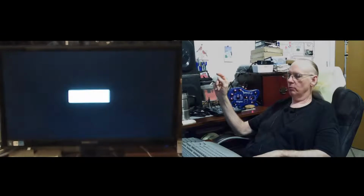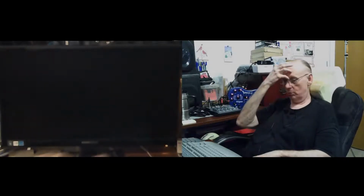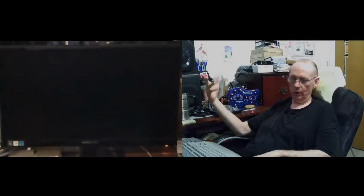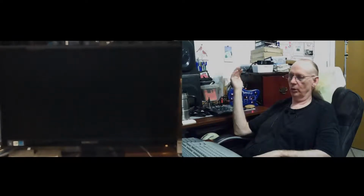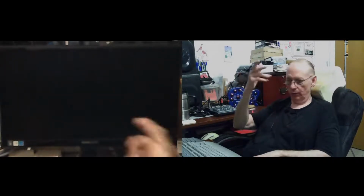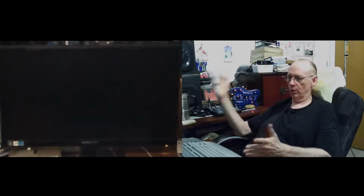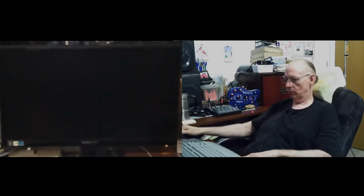That's usually what happens in regular PCs. Even though it'll happily give you the option to do this, it doesn't mean it'll work. I really don't remember ever seeing it work this way. You've got a video card, or using two, having them both active at the same time, the onboard and the video card. What you have to do is set the video card first and the VGA second, and then if something goes wrong, I guess they will work the opposite way, both at the same time. It depends on the machine and the motherboard, I guess, but with some of them you could plug your VGA in, and if it's working, you can plug and unplug the VGA all you want, and it'll just come and go on the monitor. But of course, most of the machines I've had really didn't have enough power to do both of them.